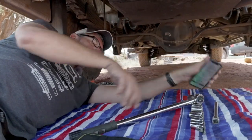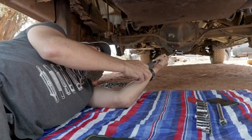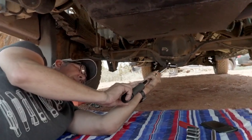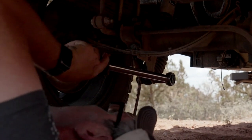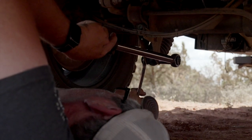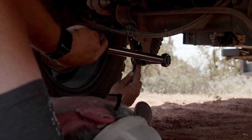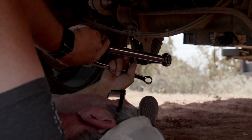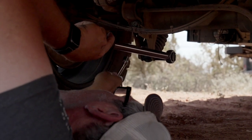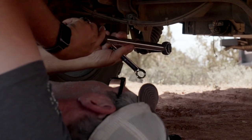This is for the lower shock bolt. What you're going to want to do is have a wrench on the other side — you may need a friend or a helper, especially for this lower shock mount. If the wrench doesn't work, you may want to use a longer breaker bar with a socket on this side to hold it together while you're torquing this one, because this is very difficult to do with a smaller wrench.